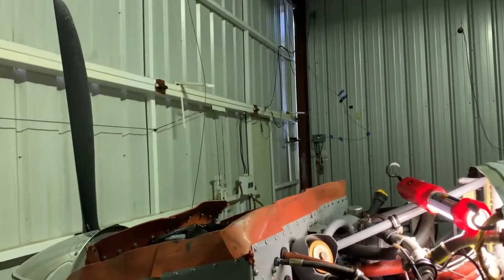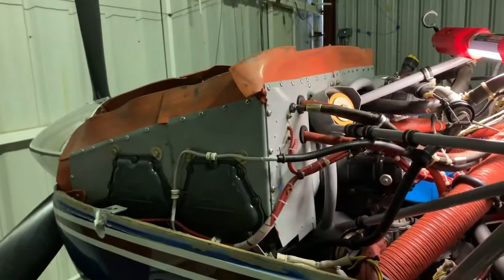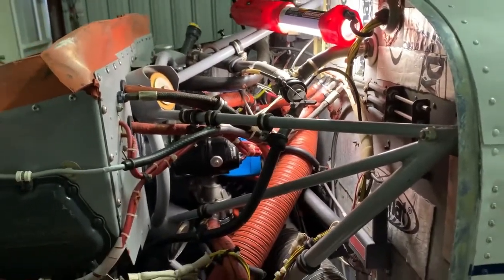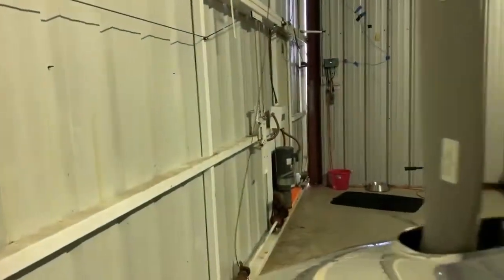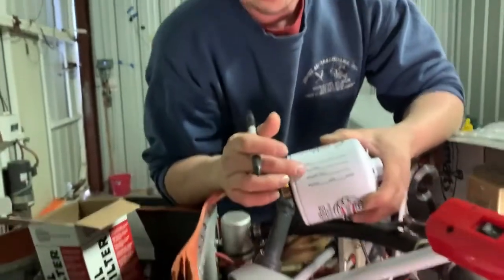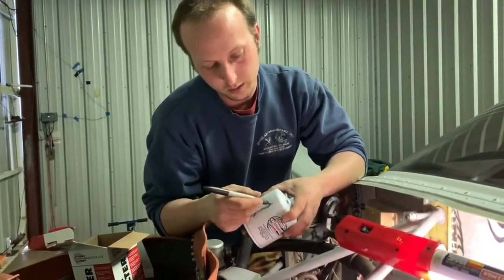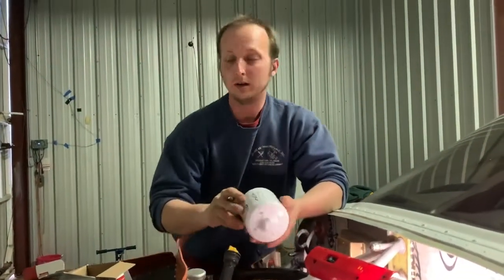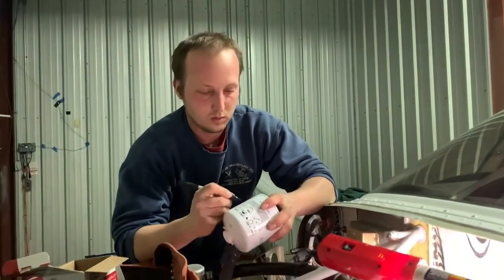Let's check the tach time: five-five-zero, three-three-five, zero. I checked as soon as I shut down yesterday and I was one hour over my oil change. Now let's prep the new filter. We're going to fill in the blanks — put today's date, the current tach time, and the aircraft registration. Since there's only one filter and no left or right, put a line through that field. Today is the 26th — so 3/26.